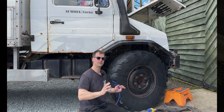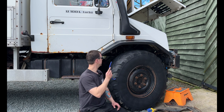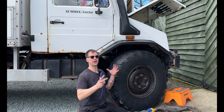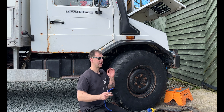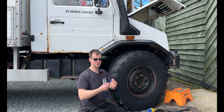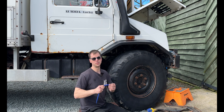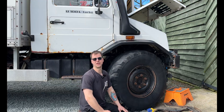It's going backwards and forwards as soon as pressure increases on it, which is a great result. If I do get a similar problem again I will be changing the actuator on the turbo because they do deteriorate - there's a lot of heat in an enclosed environment and they do wear out. But for now it's moving exactly as you'd want. I'm going to put little cable ties on the ends of each pipe as well just to stop them slipping apart, as this can create vacuum problems. Let's put this area back together and go for a little ride.